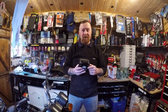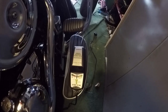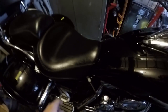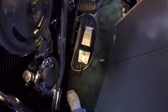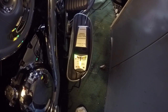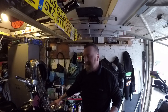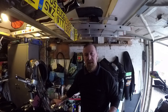Let's get in the garage. Here we are, and here's my very pretty VN 1600 Kawasaki. On here I have a Tech Mate — this is a trickle charge unit. These simply plug in; we've already connected it to the battery under here, positive and negative, and you just plug it into the mains. Once plugged in, it runs a diagnostic and tells you if your battery is really low or just needs a little bit of charge. The reason I say they're sort of leading under false pretenses is that the battery is low but you'd never know, because every time you start the bike from the garage it runs fine.